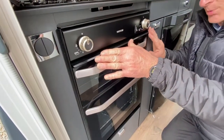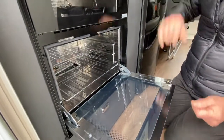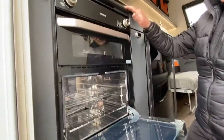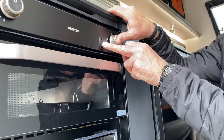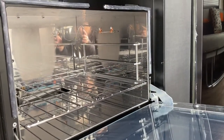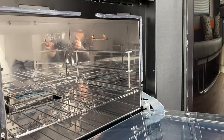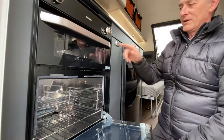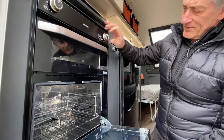You can put that plate back at that point — you don't need the plate out when the oven's in use, as that normally vents at the rear and comes through the top of the oven. Rotate the valve right around to its maximum position — the hottest heat, which is 240 degrees. Press the valve in again and strike the electronic ignition — away it goes. Keep it depressed for a few more seconds then release the valve, and rotate it down to the desired temperature. You can refer to any cooking instructions on the back of the item you're trying to heat and match those numbers, then rotate to off when finished.